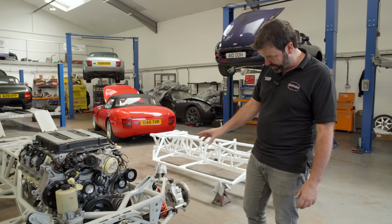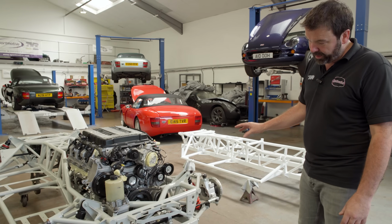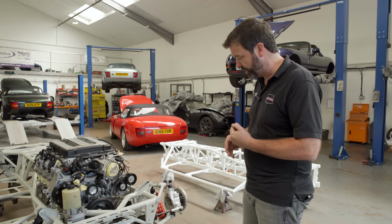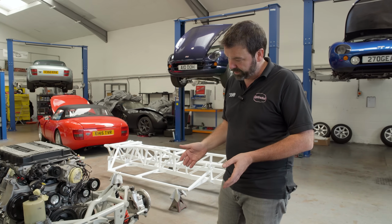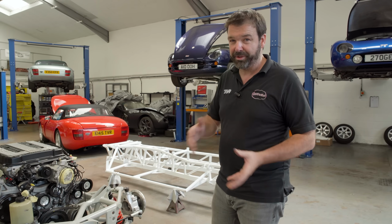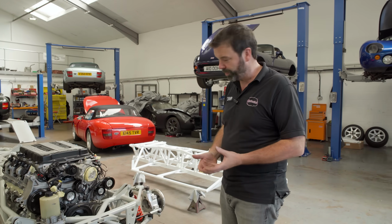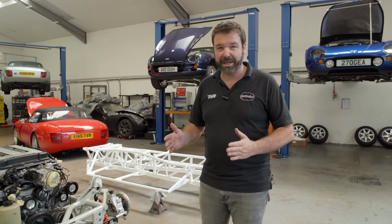We then looked at damper heights and mounting and realised there was really no reason why we couldn't have a much more upright, longer damper. Obviously, the longer the damper you can get in there, the more damping effect you've got to control. A damper and spring that are inclined creates a falling spring rate, which is fine if that's what you want, because there are certain conditions where you'd want it. On the rear, you sometimes want the falling spring rate to increase grip as you load up. But that's all you've got to work with because that's the limitation of the chassis.